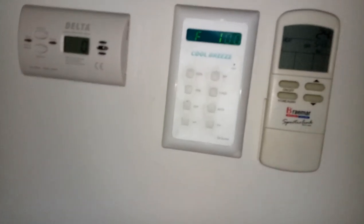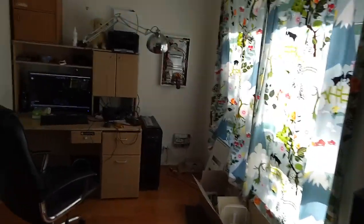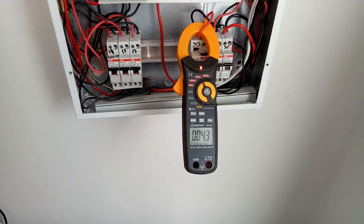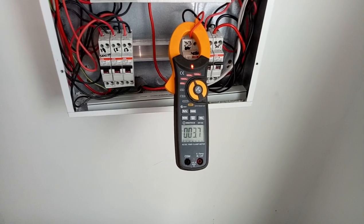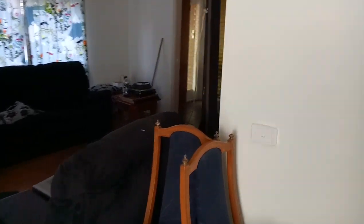We'll put it on fan mode again. I've got my ammeter on the circuit to watch the current. We're running at 2.4 right now — there we go, 4.4, coming down to 3.7 amps. Nicely running at 3.7 amps — you're looking at around 850 watts. It's a little high to be honest. What I might do is order another capacitor, because if the capacitor is a little bit shonky, you're going to get issues with that as well.